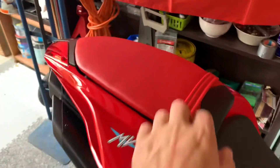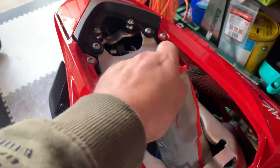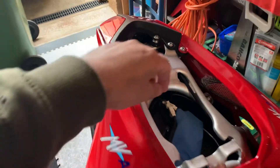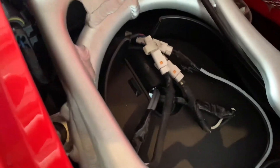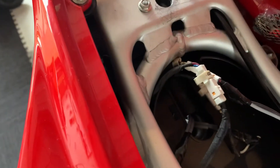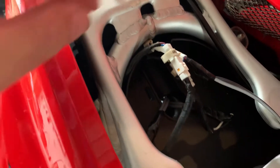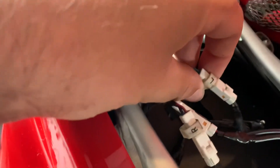And what I've done is I've removed the rear cowl — take that out — and then basically that's it there. So you cut the wires running to the old halogen indicators and you replace them with the current LED indicators.